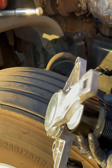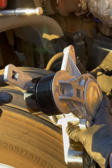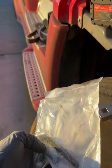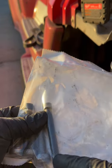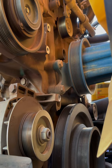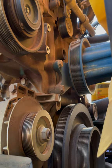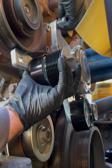So same mounting locations. It's just a little harder to loosen this guy up because it's hitting against the AC compressor. So this one's kind of a pain, but otherwise same general idea. And in case you're interested, this one came with a new kit for the bolts and actual pins to put in there, which is pretty impressive. They must have just started doing that because I don't remember that. Okay, so these new bolts, they are for a T50. So remember that when putting them on.